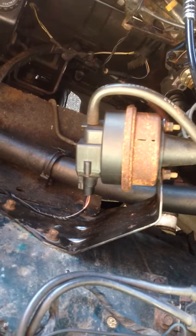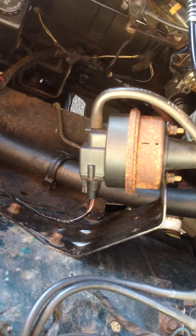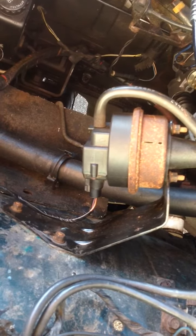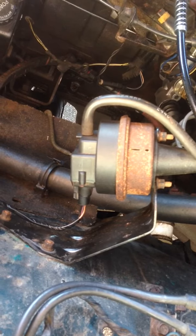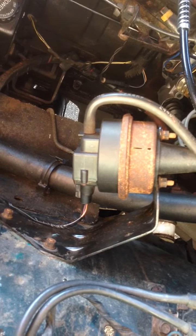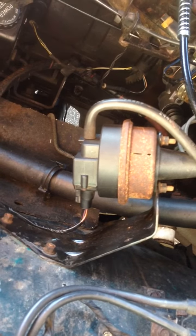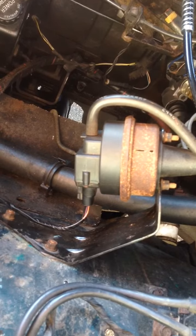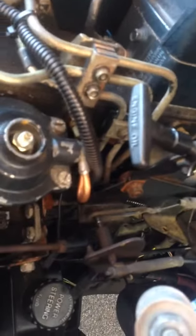There are four wires. One wire you run a power source to. The other wire is a ground and you splice off that main ground to your switches. The way the solenoid works is one ground operates the vent, so it either releases air or doesn't, and the other one lets the vacuum in. The vacuum goes on the push button, then you've got your toggle for your power and your main ground, and then it just goes to your throttle linkage.